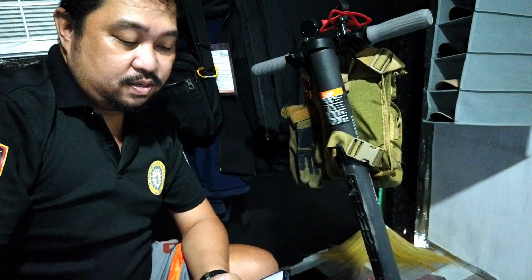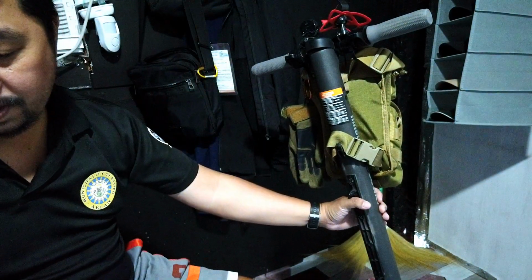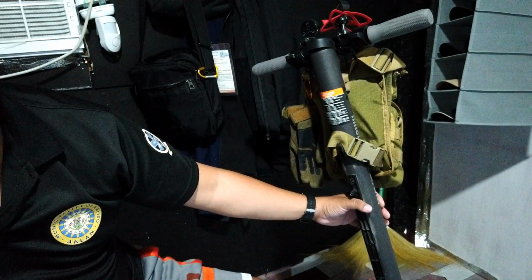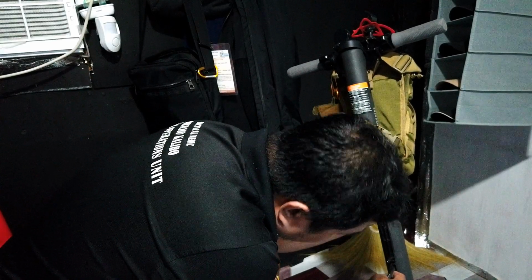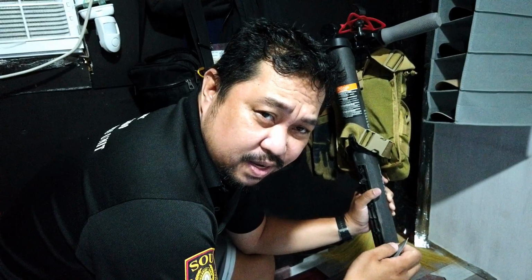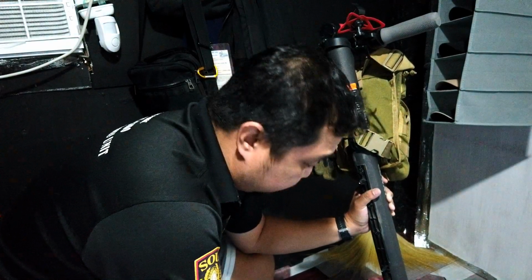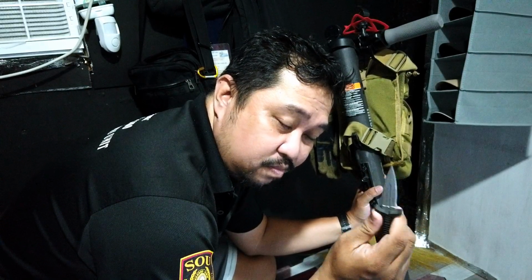So I just turned it off. Let's try to move the contact points. I'm still using my dagger. We're gonna pinch it together, not a whole lot, but pinch it a bit so that the contact points will be closer once you insert the battery. Don't pinch it too far. You're not gonna make that connection with the connector of the external battery. And use a rubber. There's still a battery there. Use a knife with a rubber handle.